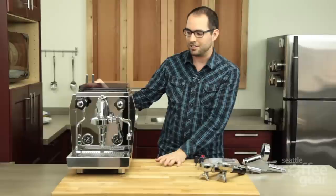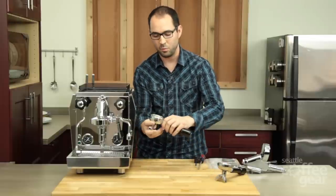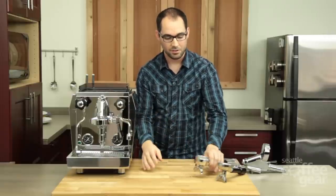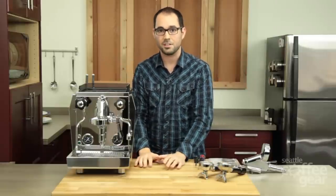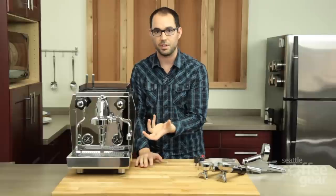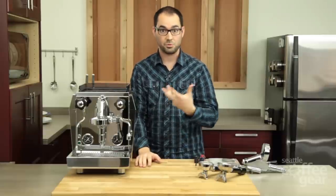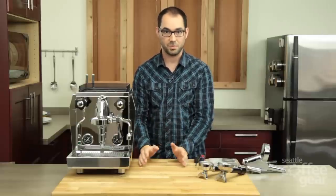Things that you'll see as an indicator to let you know that you need to tune up your brew head would be if you're seeing, while you're pulling a shot, water pouring over the top of your portafilter, or maybe even some coffee. You might also hear your pump working a lot louder, like it's struggling a little bit — that's because it's having to push through your screen with more resistance from coffee residue. Another indicator could be if your coffee is just generally tasting off, because your screen has so much residue it's affecting the taste and you're not able to distinguish from bean to bean or roast to roast.